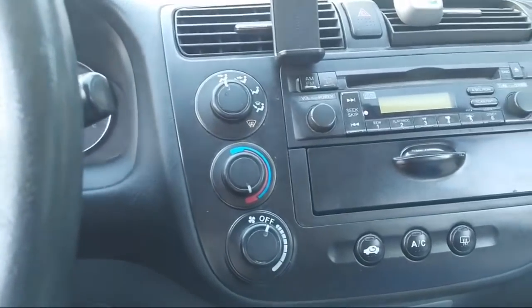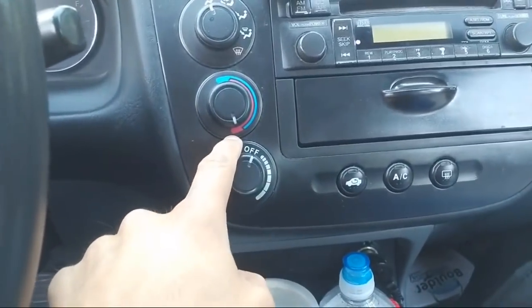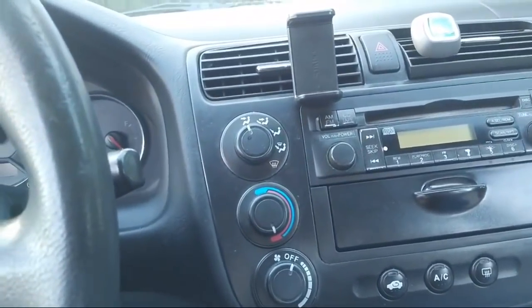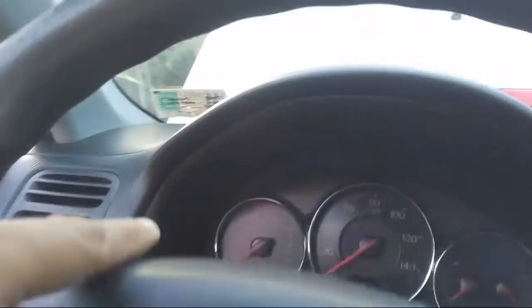The other thing I'm going to do is have the temperature set all the way up, but have the fan off. What that means is set the temperature for the heat up, but leave the fan off. Apparently that helps open up something that's going to get the coolant to run throughout the car. You may also want to press on the gas a little bit to get it up to 2,500 RPM — that'll get some other fan going in the car and helps. Basically all you're trying to do is get air out of the radiator. You're trying to burp it.